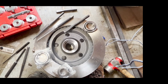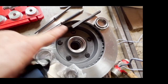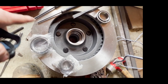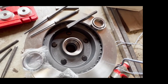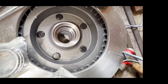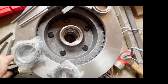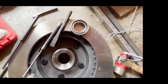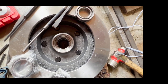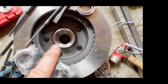Both inner and outer races that came with the new rotor have been knocked out. I had to catch both edges first with the chisel, then alternate between them to knock them out. As long as you can get an edge and start knocking it down, then start rotating it — you can get it all the way out, then flip it over and do it again. When knocking the front one out, you'll need to tip the rotor because the race will be flush with the working surface. Once you get it 99% of the way out, just tip it and give it a little tap and it'll come out the rest of the way.